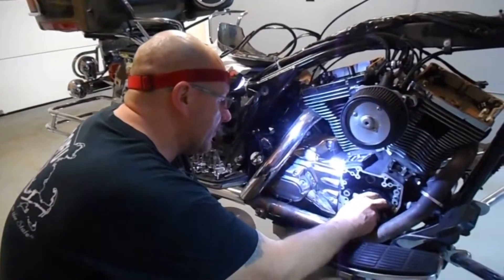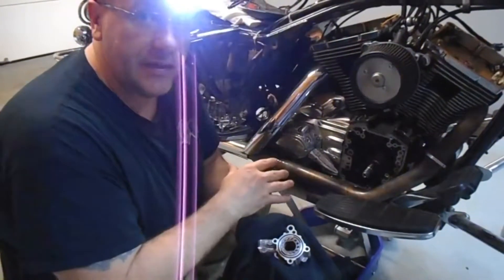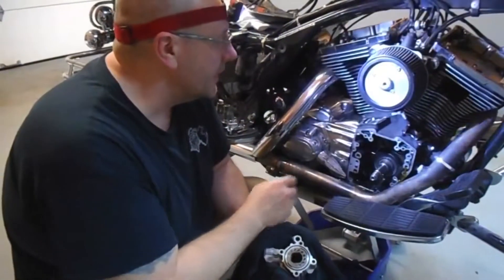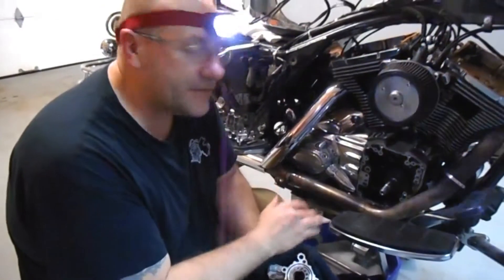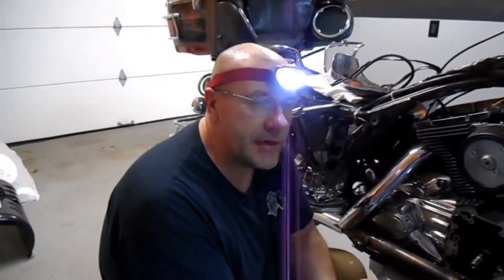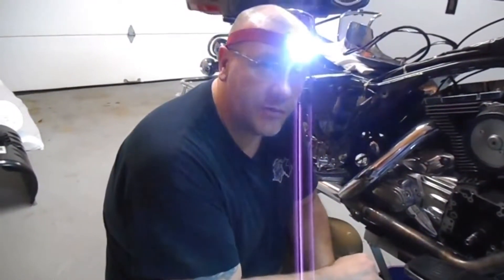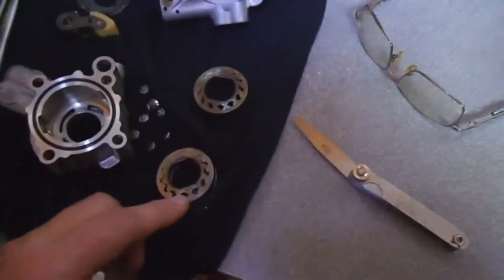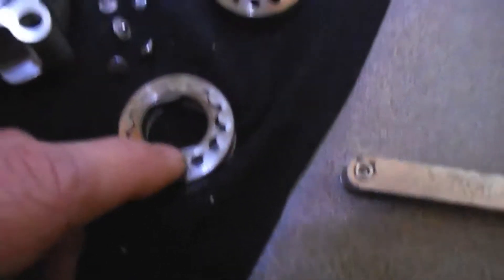The only thing left is just the oil pump. I'm going to slide her out and put her up on the bench. I'll be inspecting all the parts, cleaning all this up, all the gasket material - the old gasket material will be taken off. Then once I'm ready to assemble it, I'll come back to the video and show a little bits and pieces of putting it back together. I'm not replacing anything except the camshaft tensioners - not replacing the bearings or camshafts. I'm just doing the tensioners so I can get another season or two or three out of this bike. I checked my oil pump - everything looks good. No major scratches on anything. The clearance on the gears has to be less than .004, and they're really tight - can't even get that gauge in there. So the oil pump looks really good.